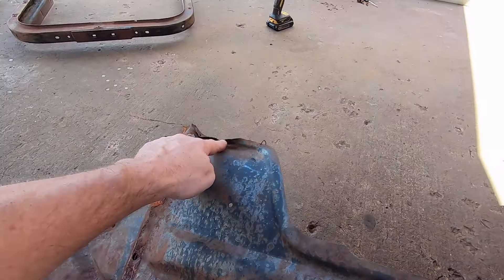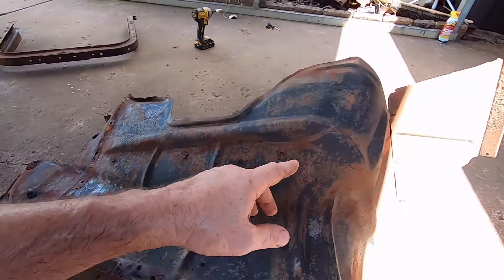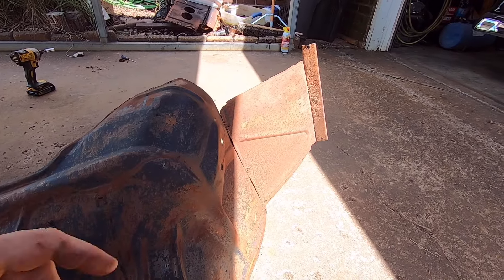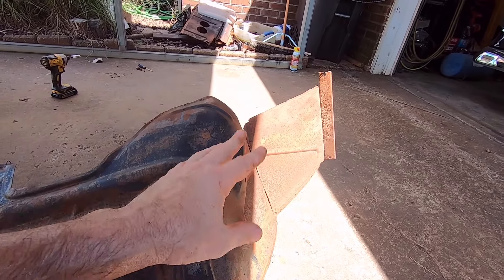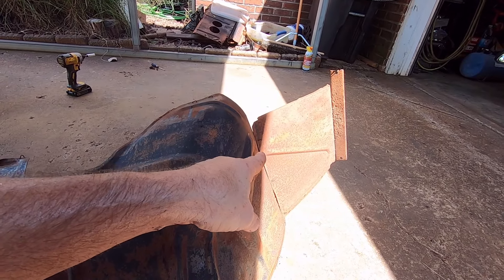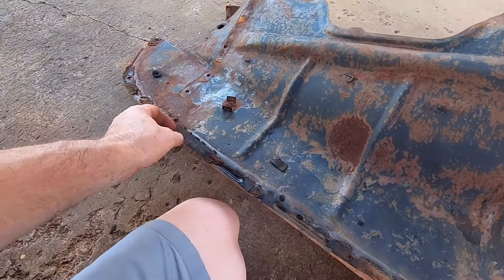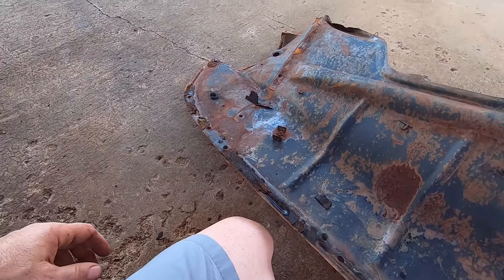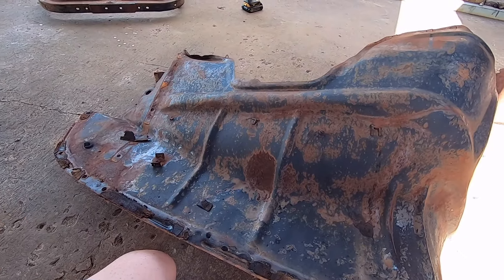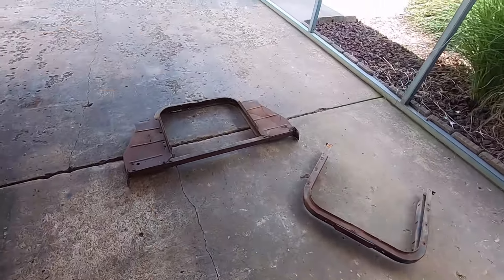This one looks okay - it just has some bent-up flanges, so I can go back in and hammer and dolly this and get it back where it needs to be. I'm probably going to end up having to hand-build these from scratch, but instead of buying new I'll just build new. I'm going to go ahead and remove that, clean some of this old seal off, and straighten these flanges out. Then I'll have to bring the fender around here and make sure its flanges are straight. I bought this core support from the salvage.